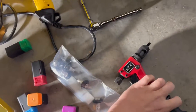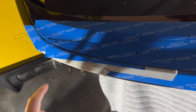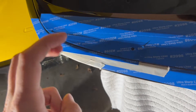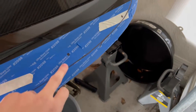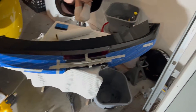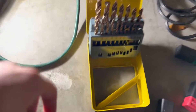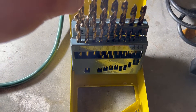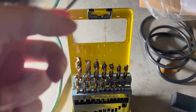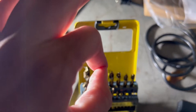After waiting on Amazon to come with my rivet nut tool, we are finally going to drill. I use this line here as my marking line, so my spacing from here and here are identical — same with the other dots — so I know I'm in the middle. The last drill bit you need is going to be that 25/64th right there. I'm just going to go through various sizes of the bits, going significantly bigger until I'm ready to stop.